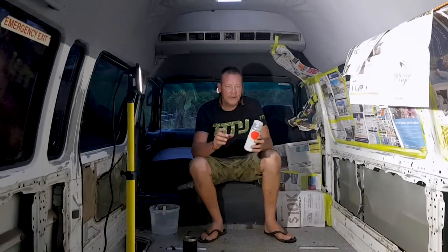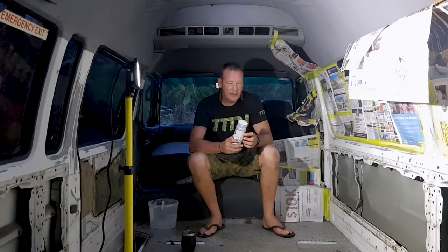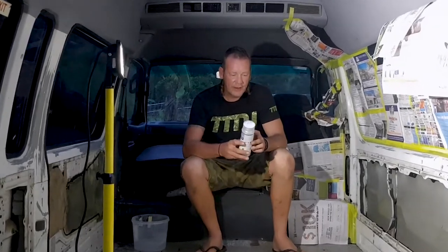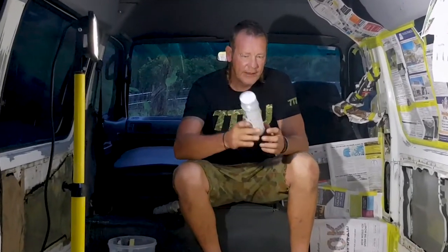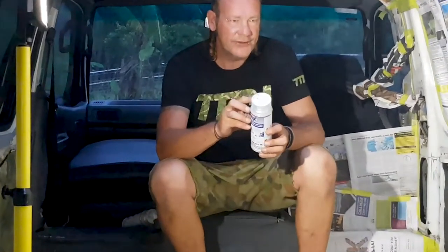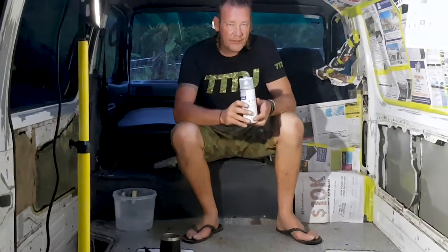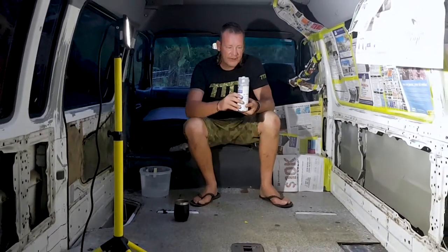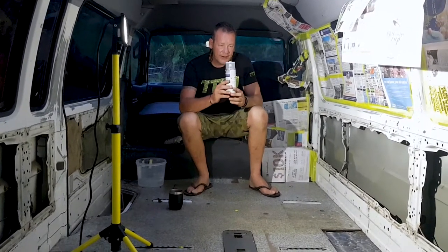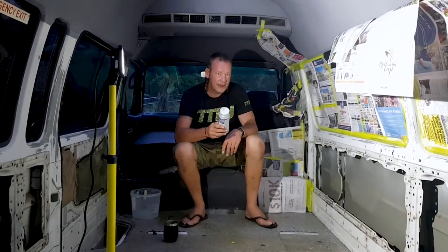Now, when buying paint, don't buy those little cans you get in most automotive shops. Go to an automotive paint shop and they'll mix up the correct colour for you and put it in a pressure pack. They're much bigger and they've got much better spray nozzles on them than the cheap little cans you buy in other automotive shops. Go to a paint shop, get the paint code off your ID tag on your van, and they'll mix up the exact colour and put it into a pressure pack for you. For little jobs like this, I find pressure packs a lot easier than using a gun.